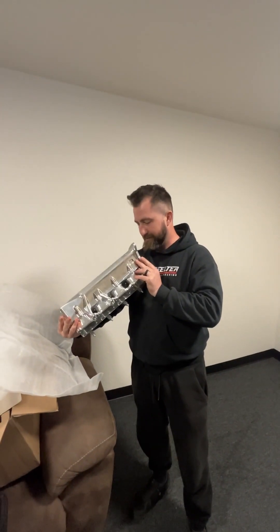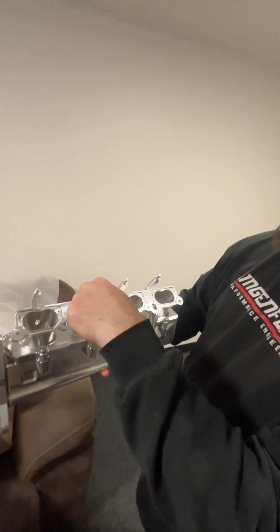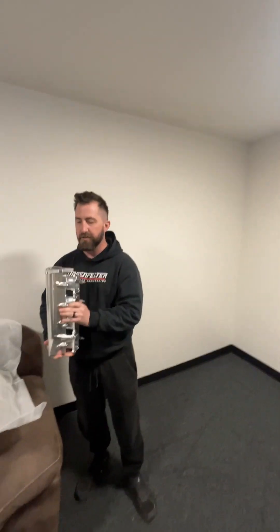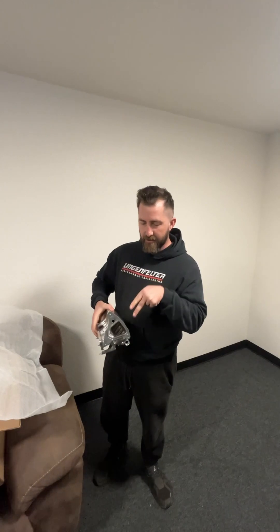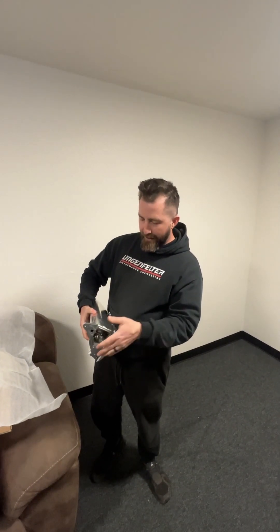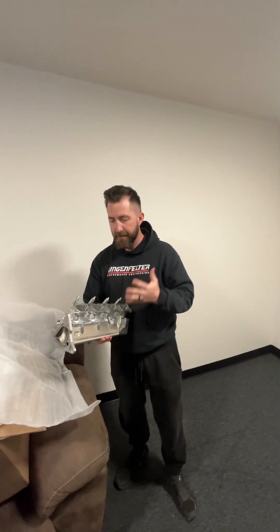We're ready to make some real power here. The injectors, Kev — this is the difference. Injectors inject directly into the intake port, which goes directly into the cylinder itself. Whereas the other things on the market, they end up sticking two injectors right there and they fog fuel randomly into the cylinder.